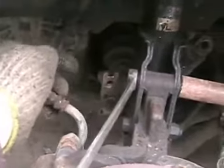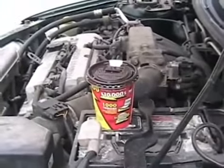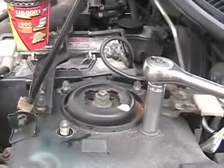So as you can see, that's all wet and juicy, and the rubber dust seal's bad too. I've undone the stabilizer link, undone the clip that holds the brake line on, and I'm ready to take the two clevis bolts out.